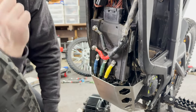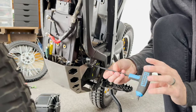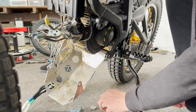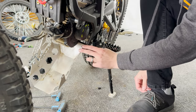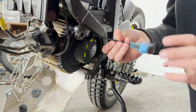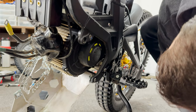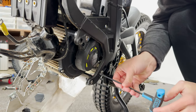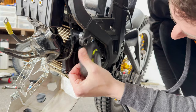Now we're going to undo these three screws on the cover — boom, boom, boom. Next up, we get our skid plate out of the way: one bolt on this side, one bolt on the other side. Save those little pieces and drop it out of the way. Next, we're going to remove this plastic cover. Our first 4mm Allen is at the top, next one is right here. Take both those out, put them to the side, and the cover should come out.